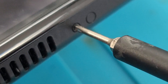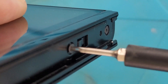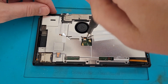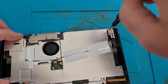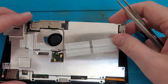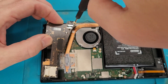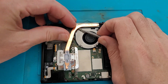First we need to remove all the screws. When the back peels off, we then need to remove the rear heat shield. Disconnect the battery straight away, then remove all the internals. Release all the ribbon cables, last few screws, and then lift the motherboard out.